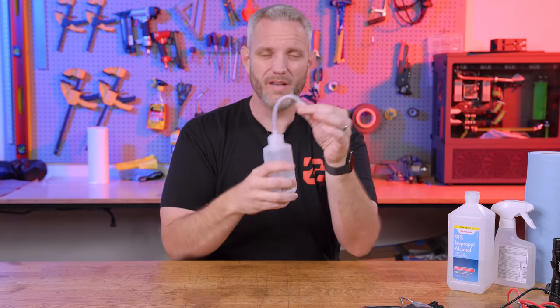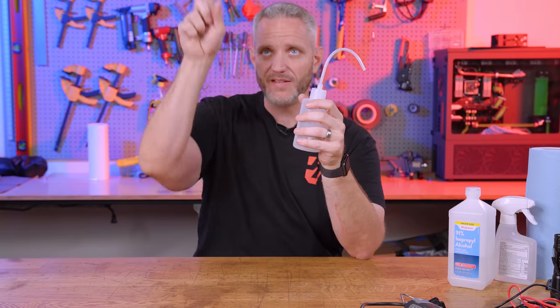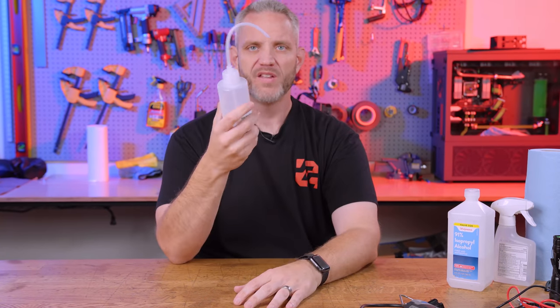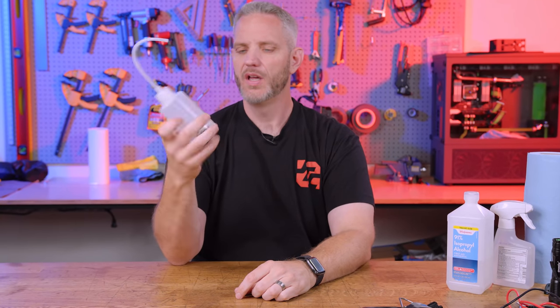For water cooling, nothing beats a basic squeezy bottle. Especially if you're dealing with distro plates these days — they're not large capacity and they're pretty thin. You've got to try and get fluid down into something that's awkward, and if you hook a fitting and a tube to it, air has to escape the same inlet the fluid is coming down and that exchange takes forever with bubbles popping everywhere. Just having a basic squeezy bottle — I think this one was like three bucks — definitely makes life a lot easier.